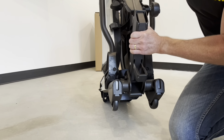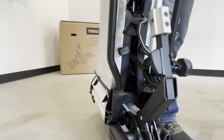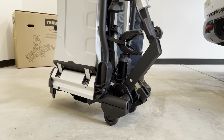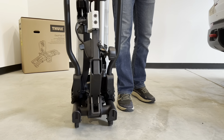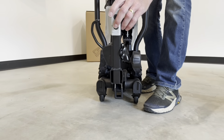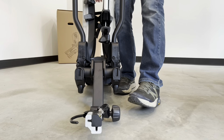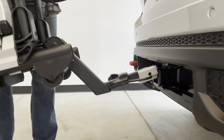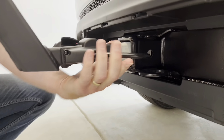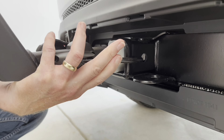On the underside here, you can see there are two wheels. What I can do is grab the handles at the top and easily and comfortably move this around from the hitch to where I want to store it in the garage, or wherever you may want to store your carrier — so you don't actually have to lift the carrier to do that. When it's time to reinstall, I'll push this hitch assembly back down until you feel and hear that click. Make sure that the auto pin is open and then go ahead and lift the carrier back to the hitch. Get it to rest on the lower portion of the hitch and bring it in. Once it's in, push in that auto pin once it's past the collar of your hitch and hold a little pressure inward as you're pushing into the hitch.